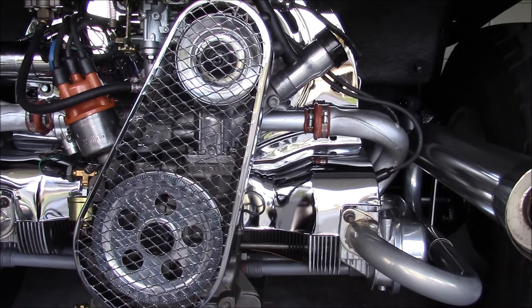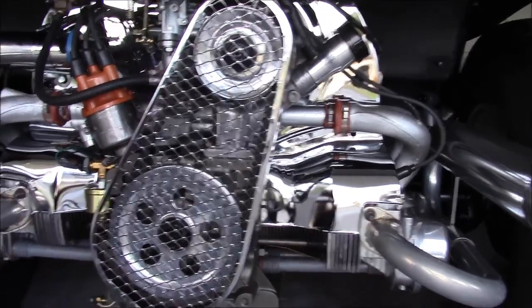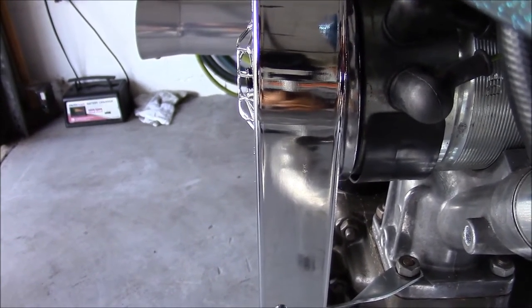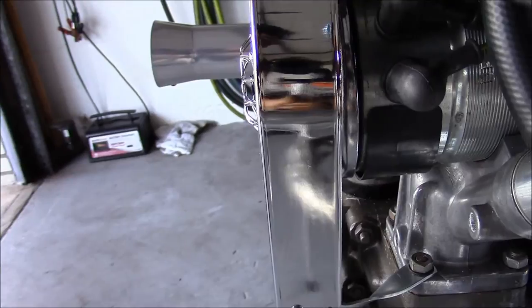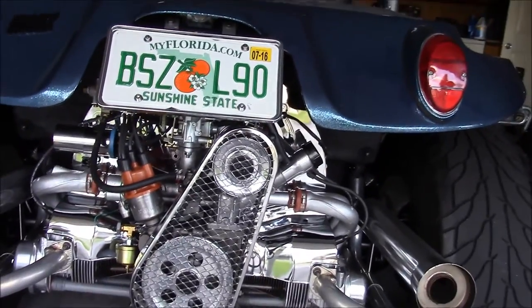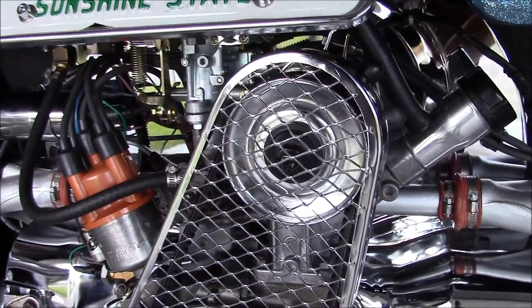Okay, it's bolted fast and it worked out real well. The pulleys are in the center of the belt protector, equal distance on both sides. The nut that used to hit on the alternator — you can see about how much it had to be knocked out, more than a quarter inch. And if you look at it, it looks a heck of a lot better than having a hole cut in there, because that's what they want you to do. But unless you're standing directly on the side, you cannot see that dimple that sticks out.